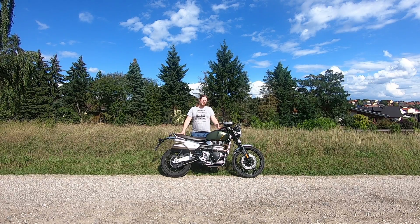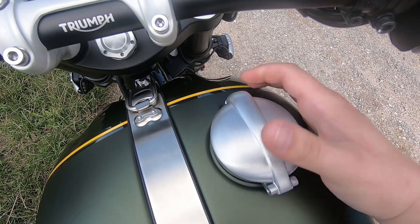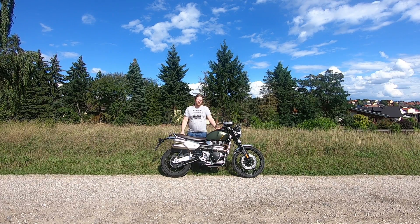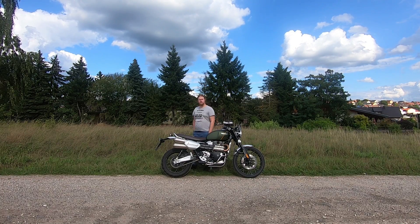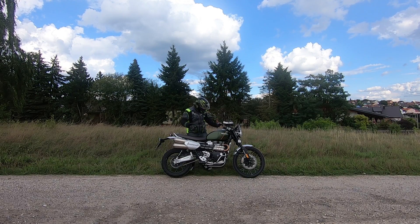The engine doesn't consume much fuel. I did four liters per 100 kilometers, with a mix of sporty and touring riding. You might get higher or lower mileage depending on your style. With the 16-liter tank, you can do around 350 to 400 kilometers, which is really good for a 1200cc twin. Also, the fuel tank is quite narrow, and the entire bike is narrow — which is important for off-roading. You don't want to push around excess weight and bulk. This makes the bike more capable and easy to handle.